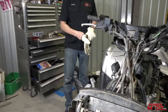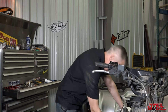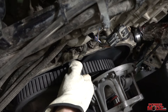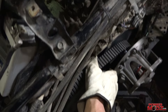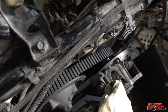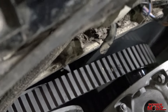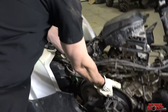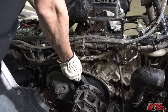If I'm going to eat my words, you're not going to see this video. This had a hard engagement on it, and that's just because this belt is so darn worn. Look at the gap between there — there's almost a quarter inch gap between that belt and the outer sheave of the primary. We're losing a lot of power to this bike; it's like starting off in second gear. That's not a good thing. What I do when I change one of these is I just spread the sheave.